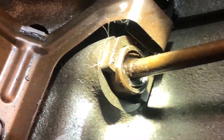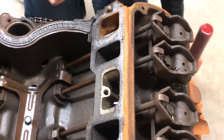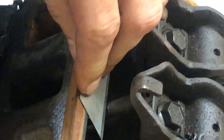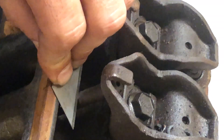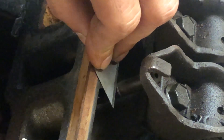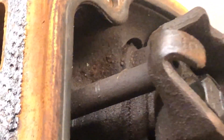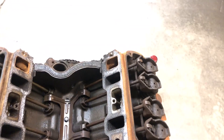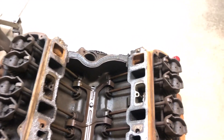I'm going to get that thing to where it's just sitting on that clip and then scrape this pushrod to get a line. Just by looking at this I can already tell that the other engine has more lifter preload than this one. I'll measure it, but it sure looks like the other one may have a little bit more. Now that those are marked, all you need is a pair of calipers - take the pushrod out and measure the distance between those two marks. They're all going to vary a little bit.